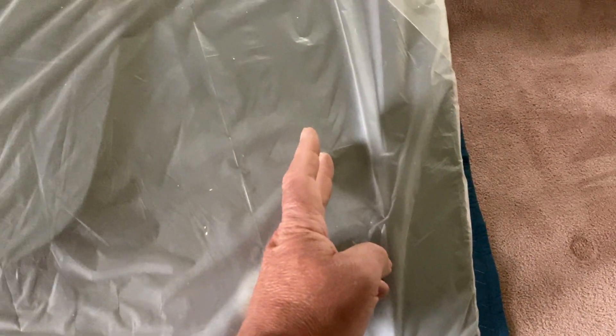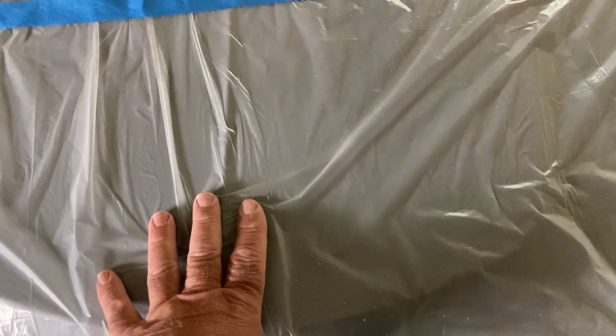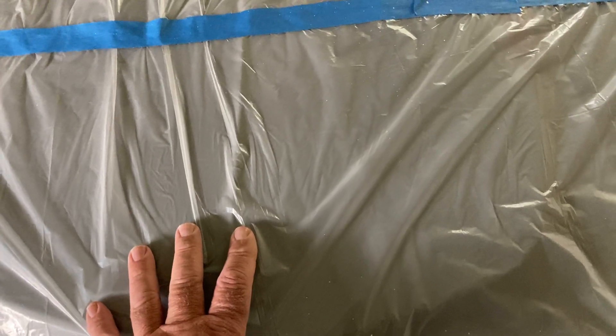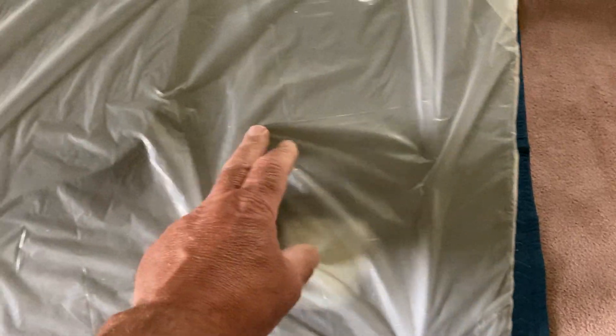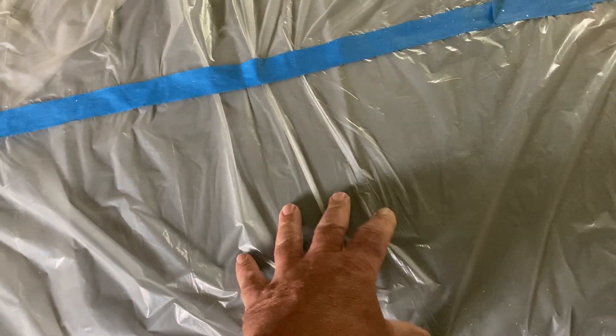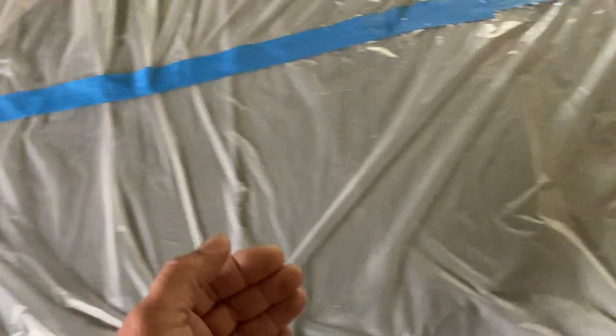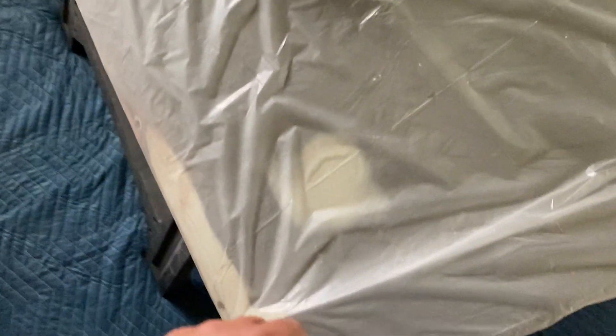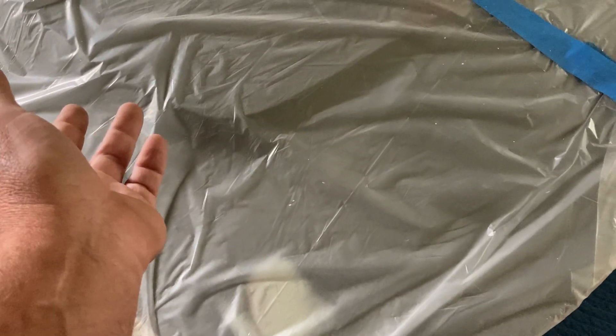For argument's sake the red only comes to roughly here, so this whole piece will be white, then the blue. We carry it down to the valance. I'm getting to the point where the weather's about to change — humidity is about to drop — and it's time to blow the bottom of this hood white, because the bottom is going pure white. Then blow in the color here, clear the hood, fade it in, so the clear will attach to the paint. Then put it on the car so it looks solid, then do the fade job. Once it's on the car, we can find the actual area on the cowl where it meets and mask off everything to shoot the white and re-clear right on the car.